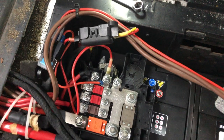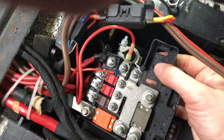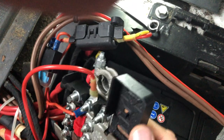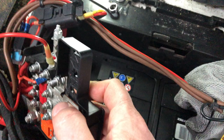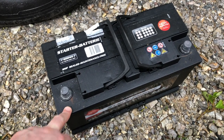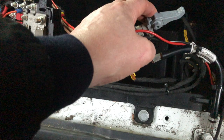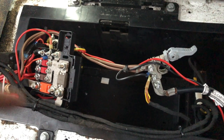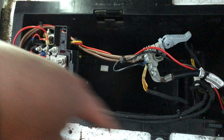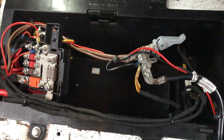Let's put that aside. The final step is just to remove the whole bracket, which comes right off like this. Now we can lift the old battery out. This was a challenge to physically lift out because quite a few of my cables had been cable tied, making it quite cumbersome. The corner of the battery was getting caught, so it's probably not going to be easy to get it back in either. Just remember: positive on this side, negative on this side — don't do it the wrong way around or you'll have to take the battery out again.